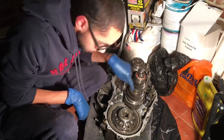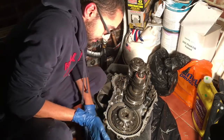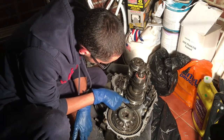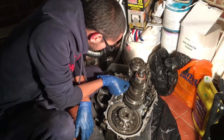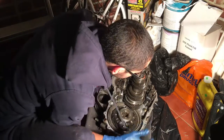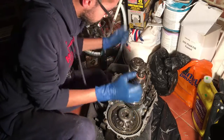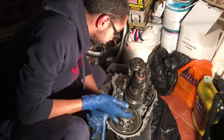I'm going to be putting on some new silicone and then put the casing back on. This transmission seems to be in working order. Here's reverse — this is the only gear that has little tiny grinds. Every other gear looks pretty spotless. Just be very careful not to get anything in here. There are dowel pins here and on top — you've got to line those up, pop it in, and then clip on the ring. I'll show you guys exactly how I do it.